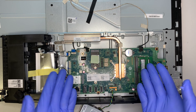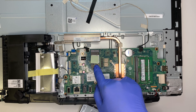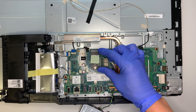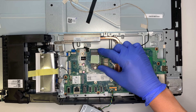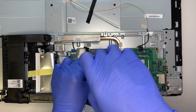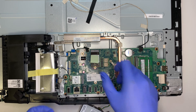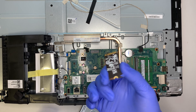At this point you're pretty much seeing the entire motherboard. Here is your C drive — the M.2 NVMe — but this version is a shorter version instead of the long version. To remove the NVMe drive and upgrade to a larger size like 1TB, you just remove one screw and the M.2 NVMe can slide straight out.